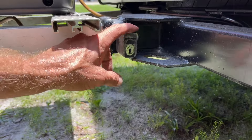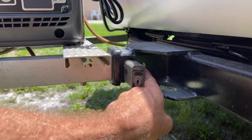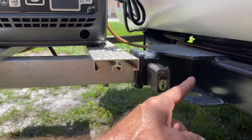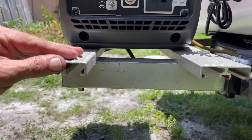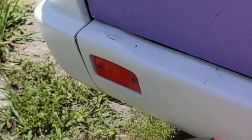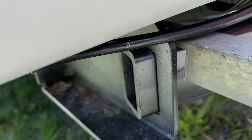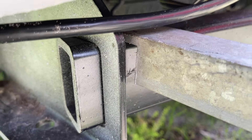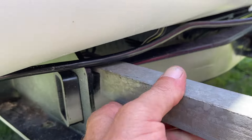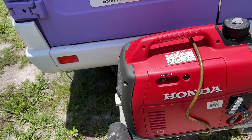I put an aluminum bar here and put a new locking hole in it because my lock is a smaller diameter than that big hole the hitch already had. Both surfaces have one steel piece over here, because I didn't want that bending — it holds some weight on this side and keeps it from wobbling too much.